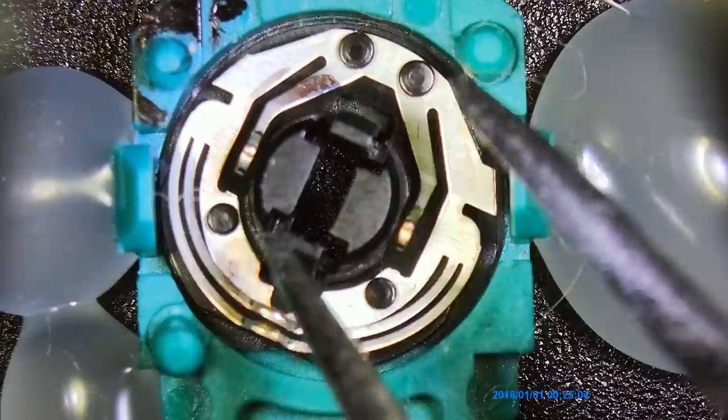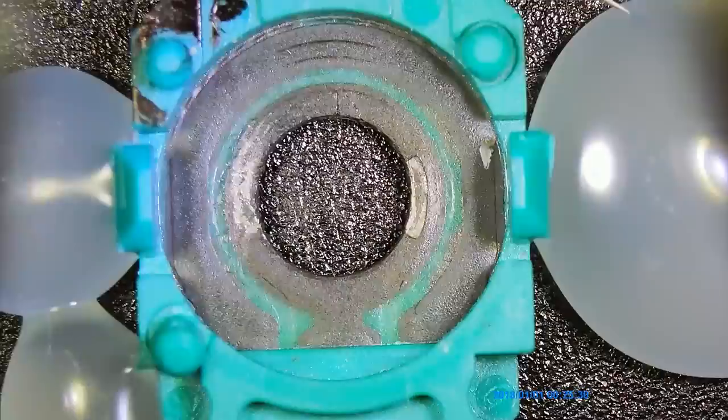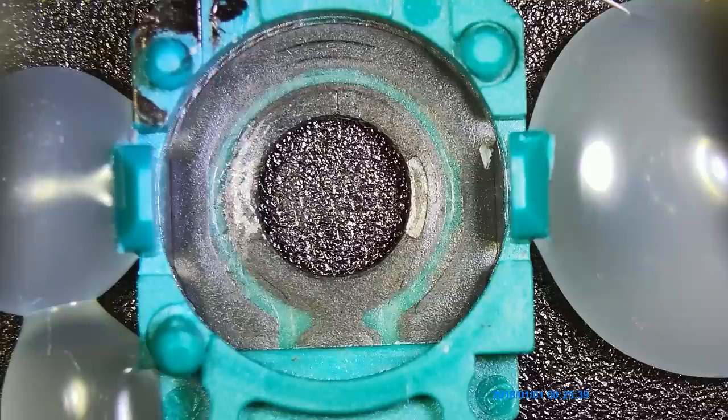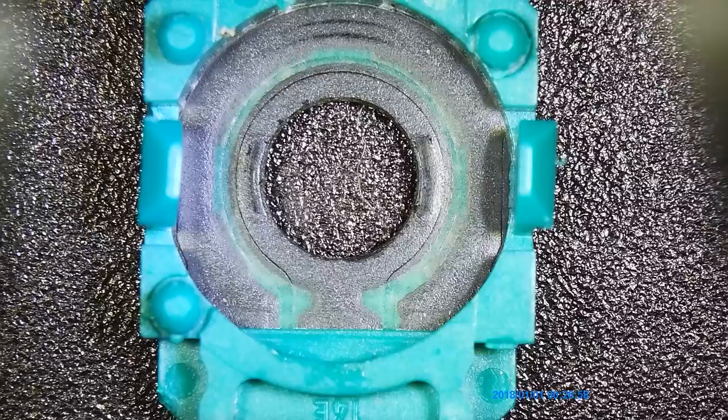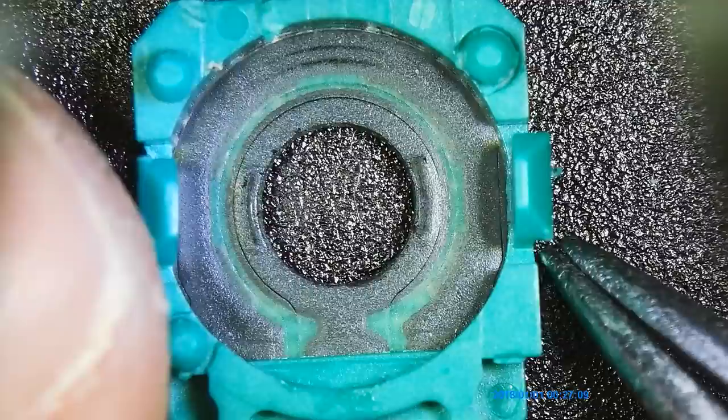You can buy these off Amazon, cheap as chips, but they have different resistance values and make the sticks overly sensitive — you don't have to move the stick very far to push it to the edge. I do have some extra potentiometers pulled off other controllers. Stick drift is actually the number one cause of me having to repair controllers. For the single-handed controllers I build for people, that is easily the number one cause of people sending them back for repair — and it's not even my fault!